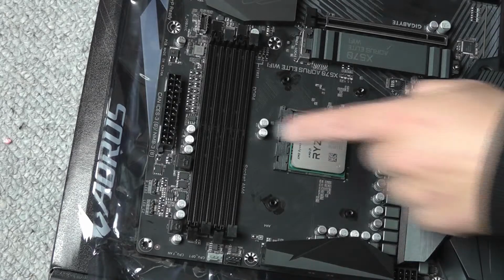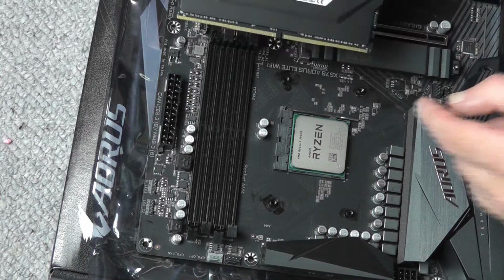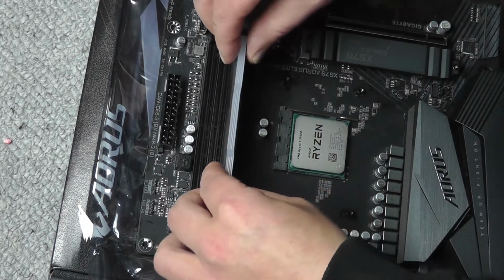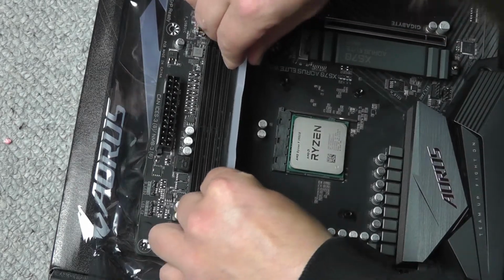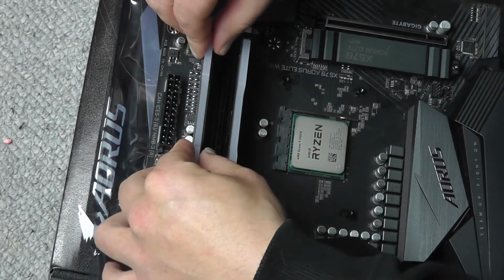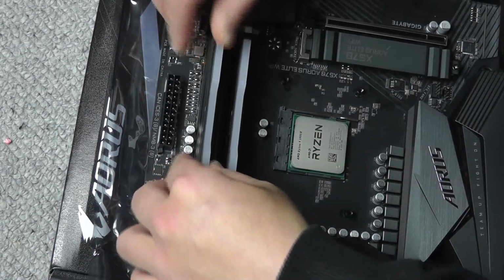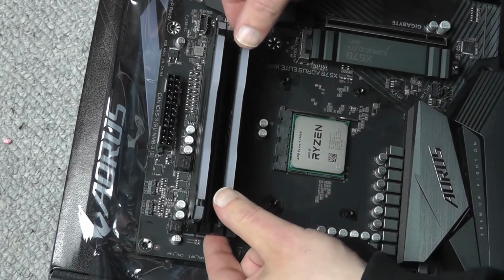Now to line your RAM up, you'll see you have a slot on your RAM and on the board. Now the left side is usually the bigger side, the slot is not in the middle, so if you just hover it over top you will see if it's off or not. And then if it is, just turn around and slip it in, apply some pressure and you should hear the tabs click, which means it's properly installed. Little wiggle for good measure never hurts.